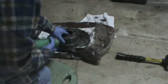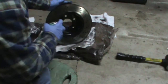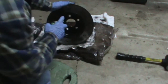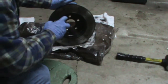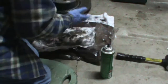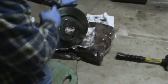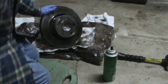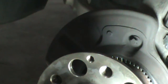Put a very thin coating of anti-seize around here and put my rotor back on. Here's the unstuck rotor — I'm going to clean off the back side and make sure there's no penetrating oil on there. Then I'll put this back on and clean the front side again after it's on.